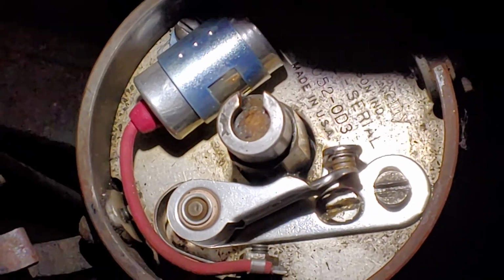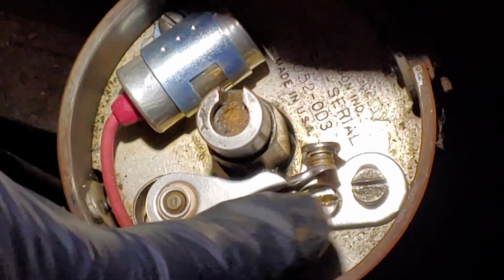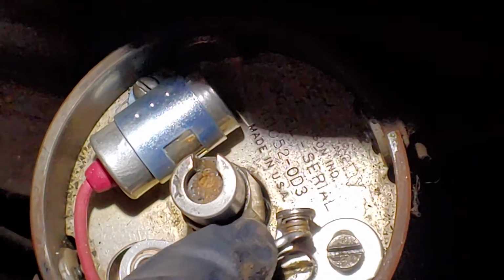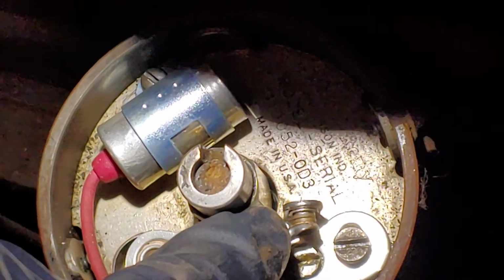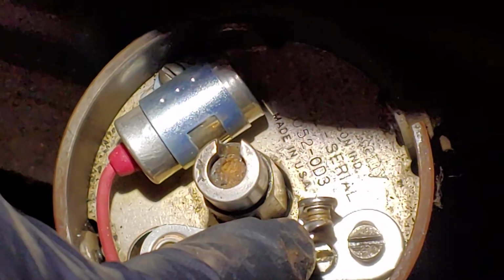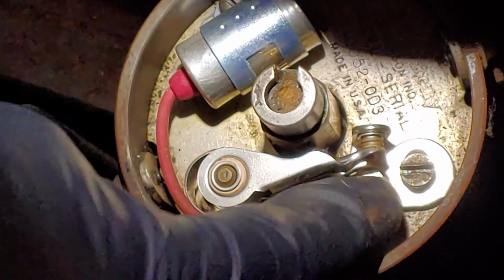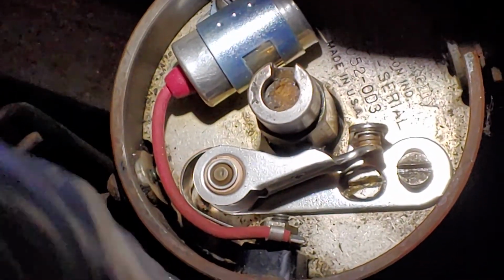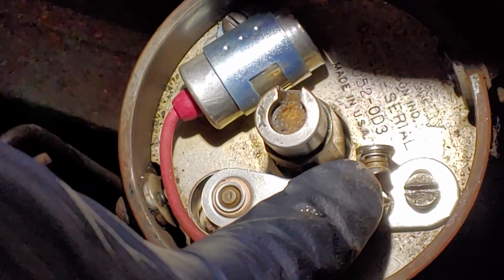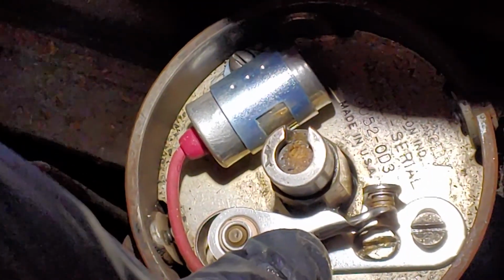Down here looking in at the distributor, here's your points right here. Okay, your contact points. They open and close. So the gap you'll be looking at is in between these two contacts right here. If you look on the little cam of the distributor here, as this rotates, there's high spots. So you want to get the engine over to these open all the way up on top of one of these high spots, and we're looking for a 16 thousandths gap right here, and that's the way to set the points. You can loosen them if you need to make adjustments. Okay, so at full open, you want the feeler gauge to go in there with some resistance, not tight, not loose, just kind of mild resistance. So we'll go ahead and run the engine over and get it up on a high spot, and we'll go from there.